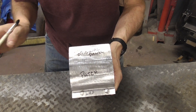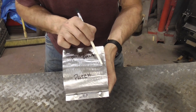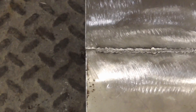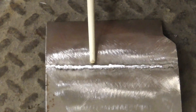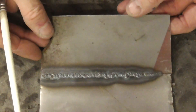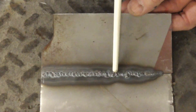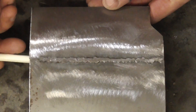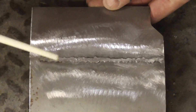Note that you need to be able to get behind it with a dolly and hammer to work out any low spots. Is this seam waterproof? I don't know. Are there any tiny pin holes, hairline gaps, or paper-thin metal from grinding? I don't know — I can't guarantee that this is waterproof. In the next example we butt welded using a gap between the sheets of metal about the thickness of the weld wire. On the outside it looks pretty solid, except for a little pit that may or may not go all the way through. Flip it over and there's good penetration in most spots, but there are a couple of gaps. When you're butt welding a patch down low, there is no access to the back of the panel, so you can't check your welds.